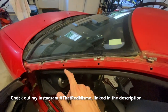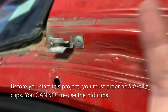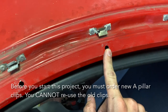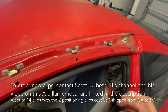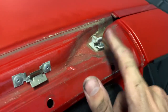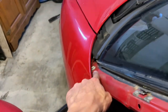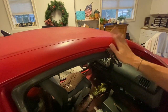Since I already have the driver's side panel removed, this is what you're gonna see once it's off. There are gonna be eight of these little T-teeth grips — I don't know what you want to call them — there are gonna be eight holes right here. You are gonna have to cut these clips. You'll have to reorder new ones from Scott Colbreath; he is Killer Three Cylinder — I'll link his video below. This clip is $15 new from Honda and Scott said he can't find it anywhere else, but it typically doesn't break. The other clip he calls a button clip — that one typically doesn't break either.